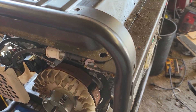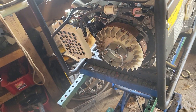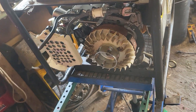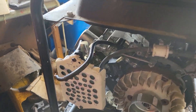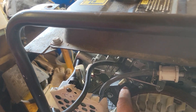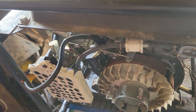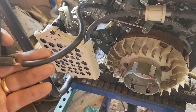I put the drill on here and spun it — it's disconnected — no spark whatsoever. Then I decided to do some tests. It's hard to test the coil, but on the kill tab I got 1.5 ohms. But on this, with that on it, I got infinite resistance.